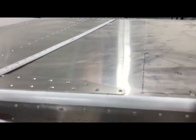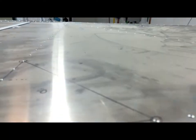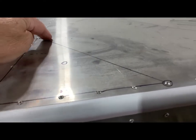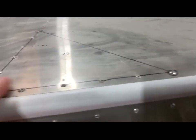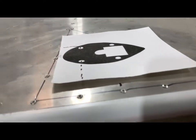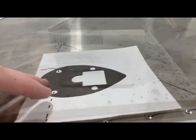Going to show where I'm planning on putting the comm antenna on the pilot side. I'd already marked this out. There's a forward section just behind this area where I'm planning on putting an L-angle - those L-angles I made. This piece is going to have another plate inside the fuselage, just another plate attached to that L-angle. There's an L-angle right here and another support right here, so I'll have another plate attached to give it more thickness to support my comm antenna, which I plan on going right there somewhere.